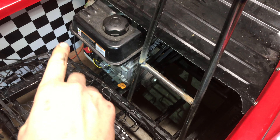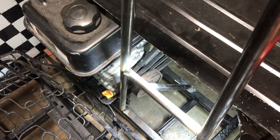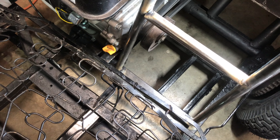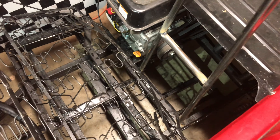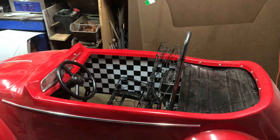It's kind of tight in here. Going on the other side of that engine would require me to kick it back and it was just getting too many complicated bends. So I kicked a little kickstand back to that back piece of frame, put a crossbar there that falls underneath the bead-rolled section, and the battery will go down in that little tray. We clear the clutch by about a half inch - it just barely clears, but it does clear. I'm pretty certain it's probably the only place we can put a roll bar in. It might be a little tall if I decide to go with a convertible top eventually, but sitting in it that clears his head by a couple inches. I could certainly shorten it a little bit, but we're going to leave it for right now.